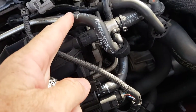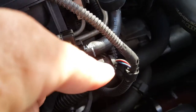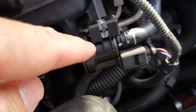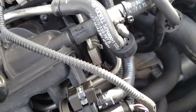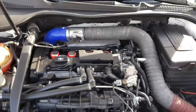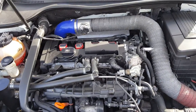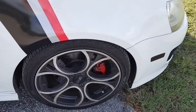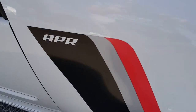From this hose all the way down is new — it goes up into here and around, and this is the purge valve right here with a one-time-only clip. The valve was only $23, the hoses that connect to it are $36, and the gas cap was $46. That's basically all my problem was. If you have a GTI and you smell a little fuel in the cabin, it could be your purge valve letting vapor into the cabin. The purge valve is supposed to route those vapors back through the engine to be burnt up.